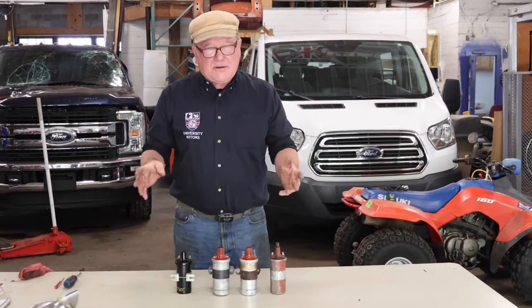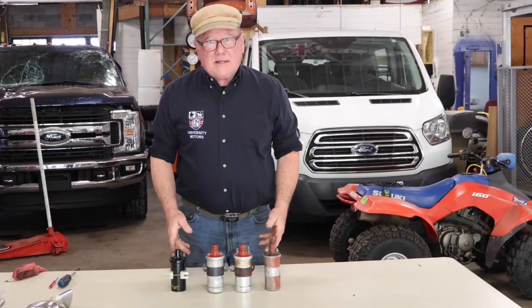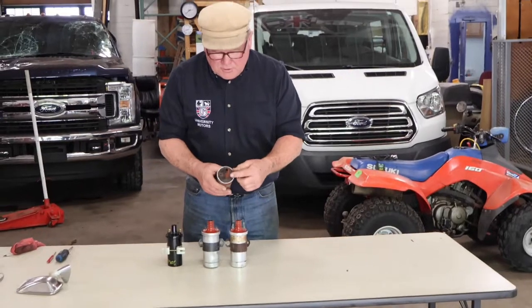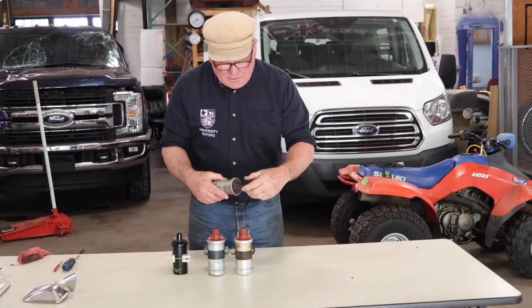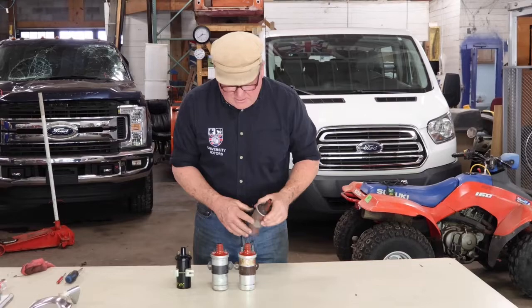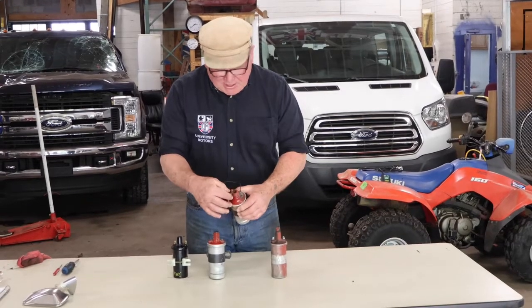Except 75 through 79 — if it's powered with the white with green wires, that's the reduced voltage. This is an old-style Lucas coil with a really cool screw-in cap, but this has got spade terminals on it. This is a Lucas sports coil, also with a screw-in cap, with spades on it.